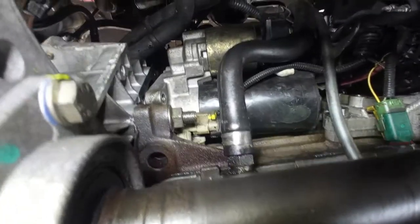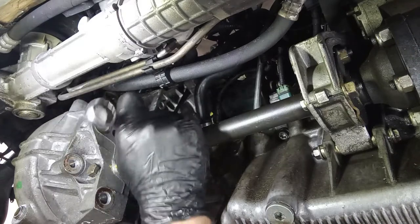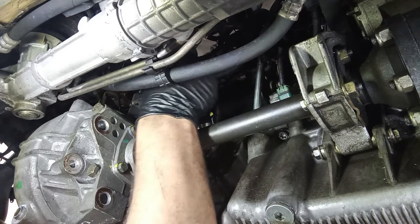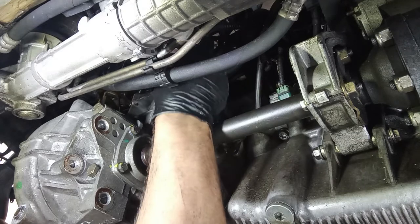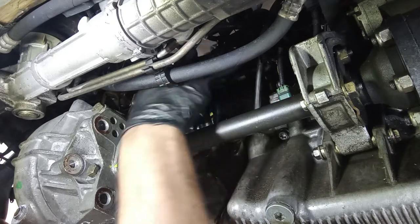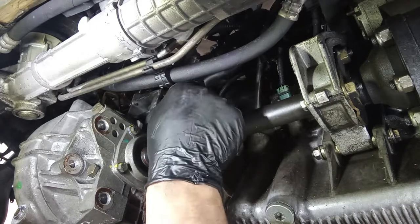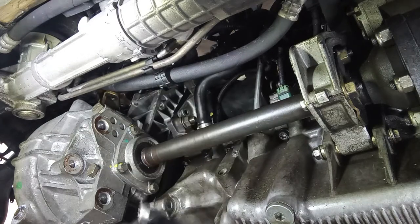As we are here, we can take out that 18mm nut. Again, not very tightened. I really hope the guides from this gearbox to the engine are good, because this nut was not very tight, which means sometimes... And if you wonder, can I do this already? Yes, I can. Why not? I mean, with the weight of the gearbox still on the engine. Yes, I can. I will leave the front nut to go as the only one remaining.